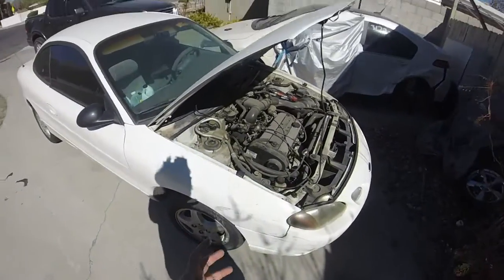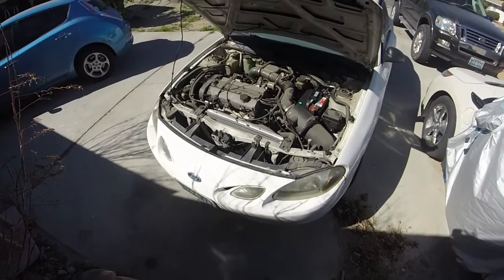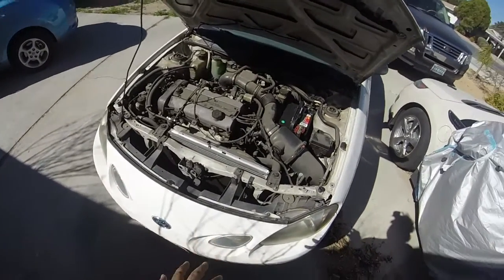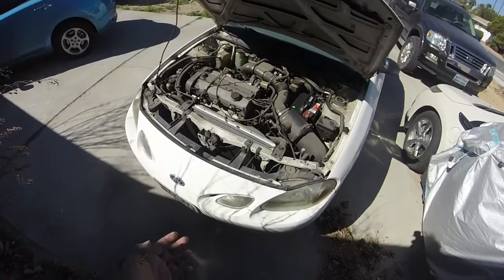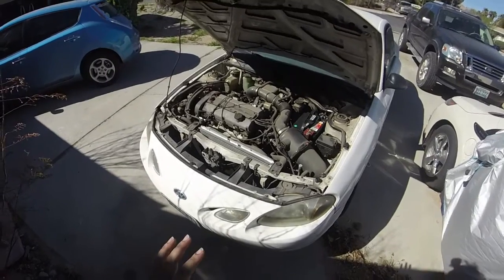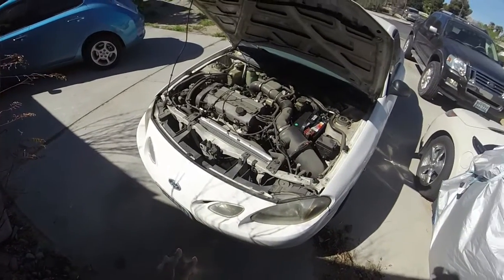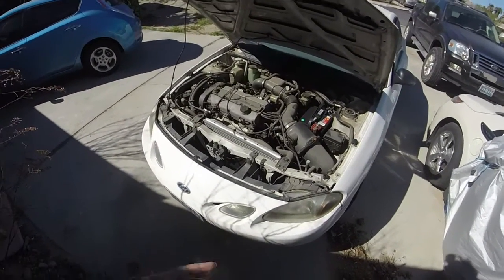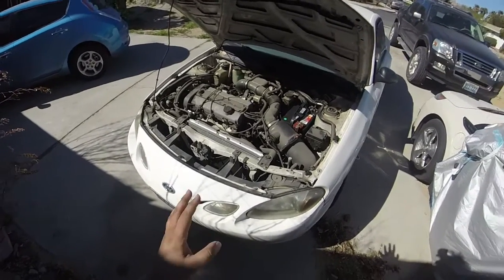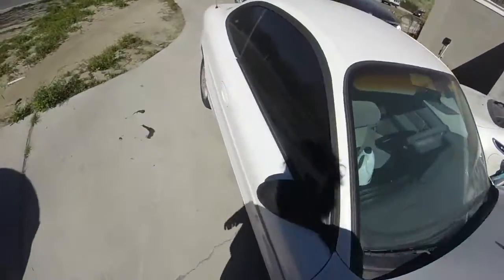While the engine heats up, let me explain what the problem was. This car has variable cam timing, and the cam timing is actually controlled hydraulically via oil pressure. Because this car has been sitting for two years, with massive temperature variations in Las Vegas between night and day, all the engine oil that was in the head and valve system went back down to the sump. The knocking sound came because it didn't have the correct oil pressure in the VCT system to get the cams into their correct position. Now that we've had it running, there's oil back in the valve train and it runs pretty smooth — considering it's been sitting for two years. Half the time these Fords just fix themselves.